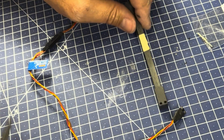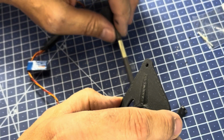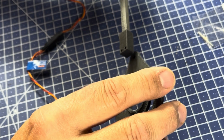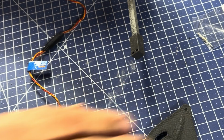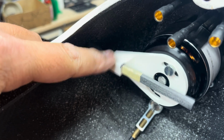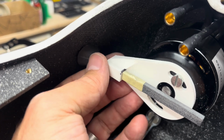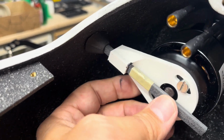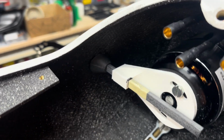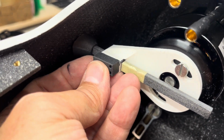For this, I designed a system that I put on the engine with the hole and the magnet here, which will be positioned right at the right position to make it possible to stop the prop. To position this magnet very precisely, I designed a masterpiece, which is just able to hold this bar going inside the fuselage like this. With this, I can measure the perfect dimension where I need to put the magnet. And the head is exactly this, minus 4 millimeters.